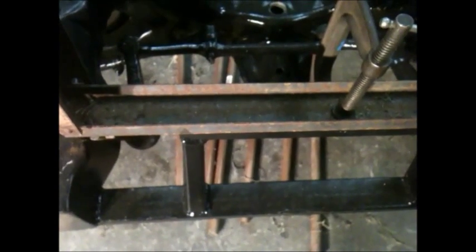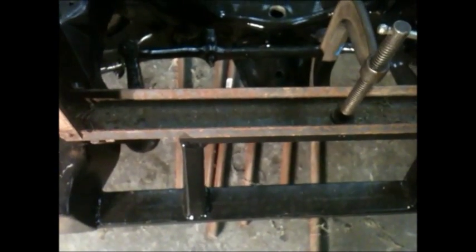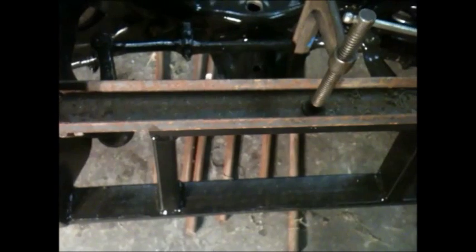The way I'm going to do this is, on this bottom piece here, I'm going to have a slot in it from side to side in two places. And then on this piece here, I'm going to slot it this way so that I have about an inch of travel in all four directions. That'll give me a little bit of room to tweak the sheet metal and align it so that it fits better when I get to the point where I'm putting it back together.